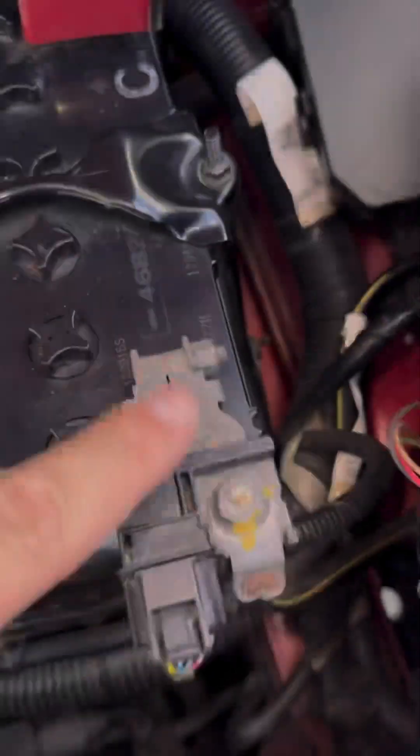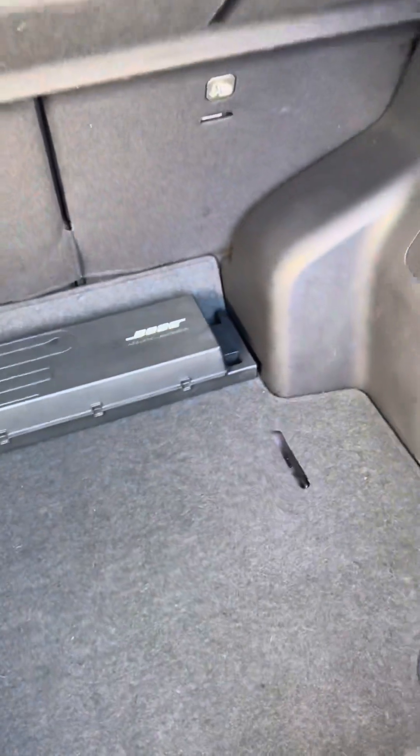Checking coolant — it's on its level. Brake fluid — check, it's on its level. Battery negative and battery positive are fairly clean. When it comes to batteries, remember that full electric vehicles don't have any batteries inside under the trunk. The high-voltage batteries in electric vehicles are located under the car, because they require a bigger, high-capacity, high-voltage battery, which in most cases is liquid-cooled or cooled by the air conditioning system. Absolutely no maintenance is needed — which is way better than hybrid cars. Oh, and I forgot — the fuel treatment.